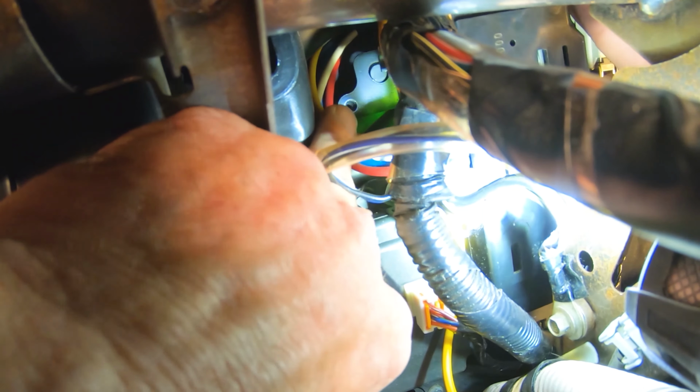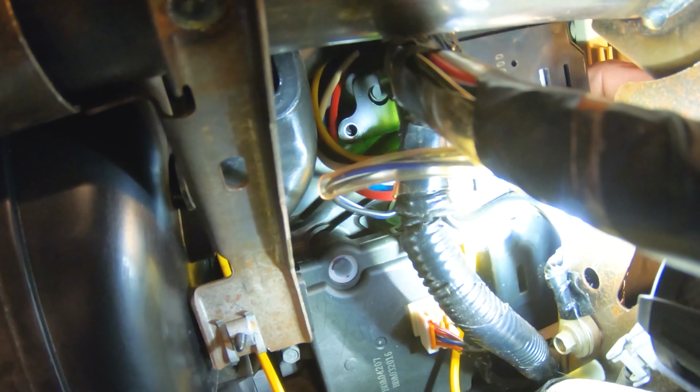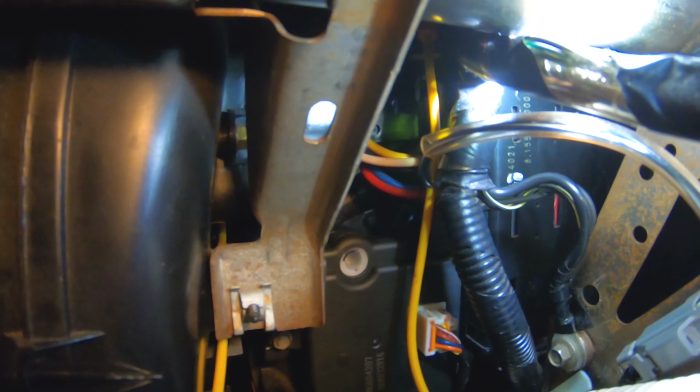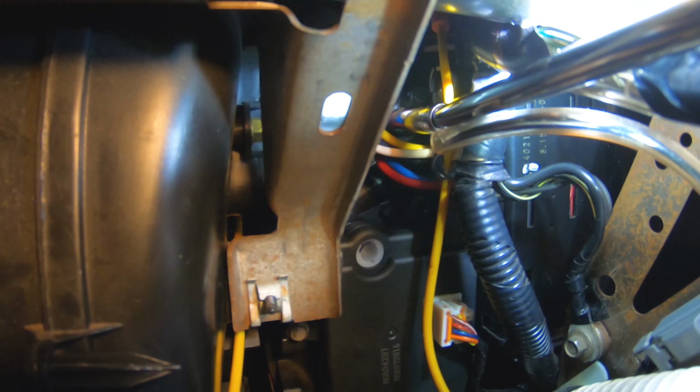Now, here there's the locating dowel at the top, and there's where this screw that we just put in the socket is going to go. And this one, again, we can use the extension and just sort of guide it back in and not have the screw hopefully fall out while we're doing so. That's the purpose of the Vaseline, and I'm using a wobble extension. If you see, the socket has a little bit of movement, just enough to help you out, and I do believe it started in. Yep, it's turning in. Okay, after this is pretty much the last real pain on this. The rest of this is pretty easy.